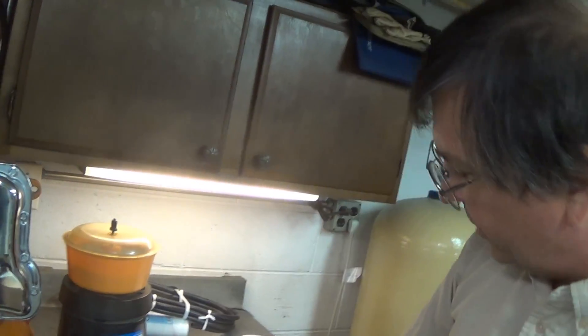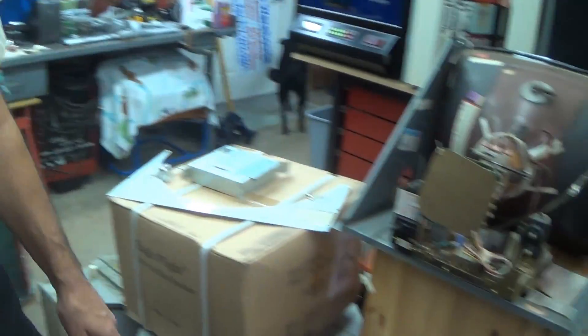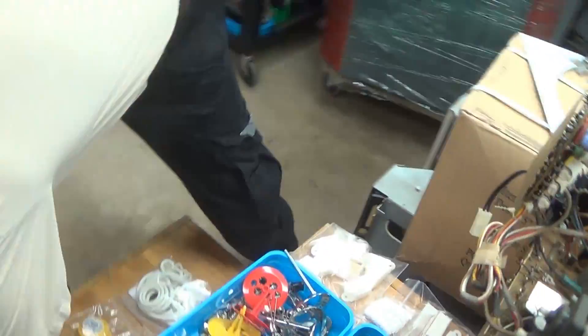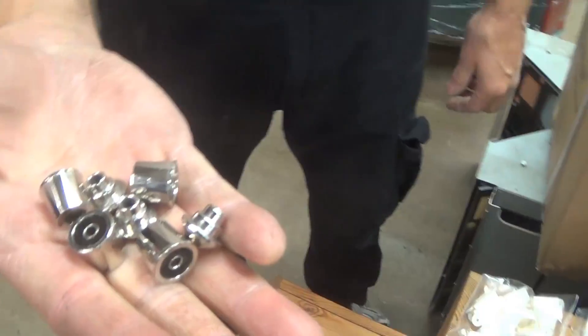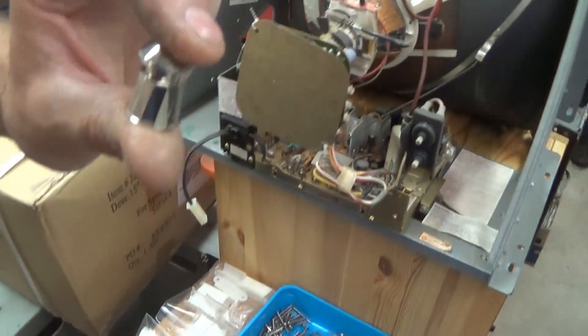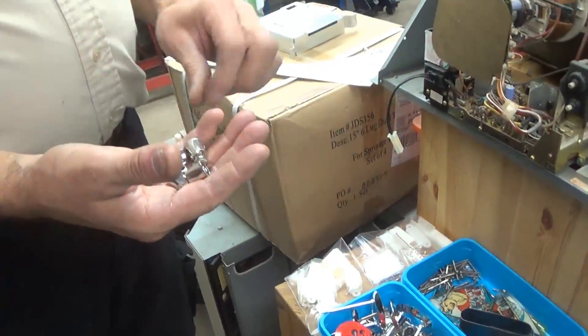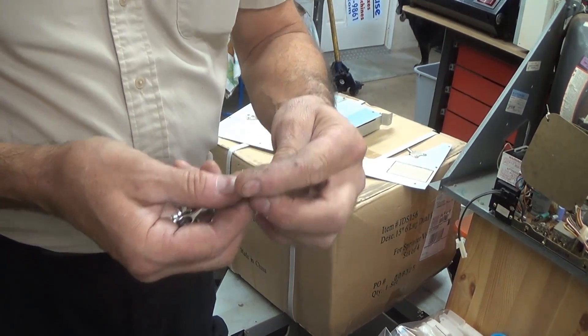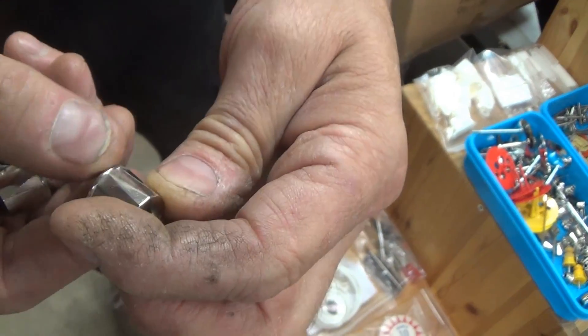These actually look rusty — they're aluminum or steel — 50 to 60-year-old playfield posts. Two-piece metal posts: the ring goes in there and that's what a post is. I leave this running for a day or two with the additive in it. Even still you'll see some patchiness, but it's much worse if you run it less.